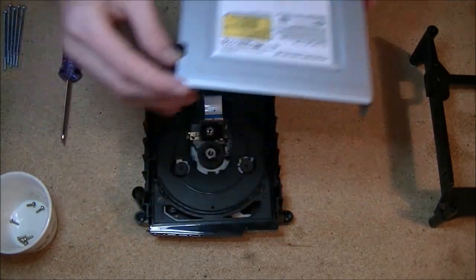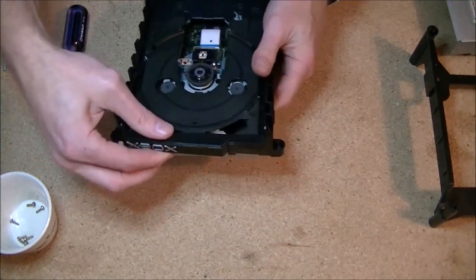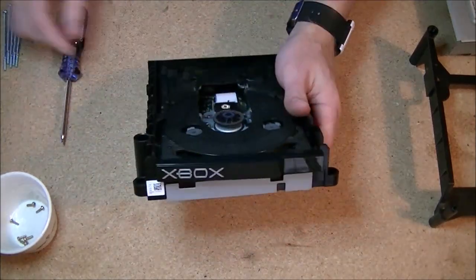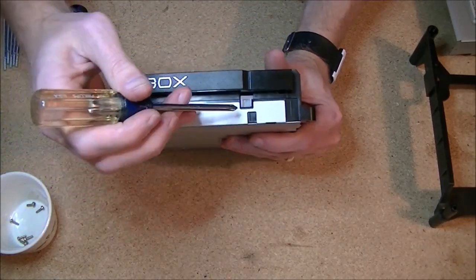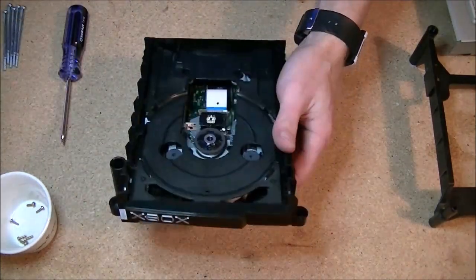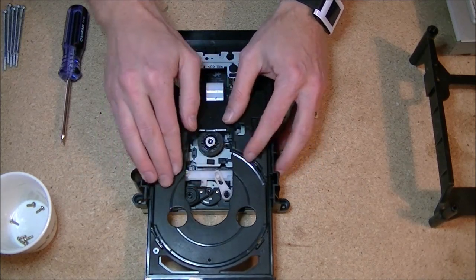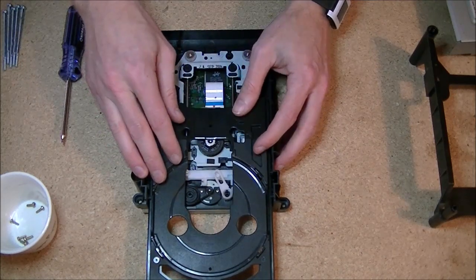We still need the drive to open because otherwise it's a little resistant to getting to the band underneath, which is causing our issue. Take your screwdriver or some other straight device — you'll see this little plastic piece right here. Push in on it gently until the drive starts to release; as soon as it starts to release, stop pushing, put your device back down, and slide it back open. This band right here, where this wheel is — it does spin, it does open intermittently — but this band is the issue.